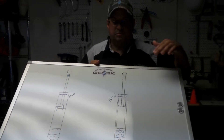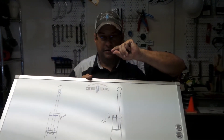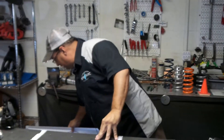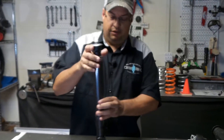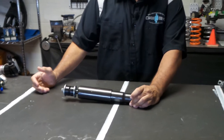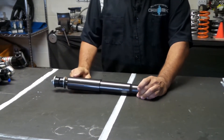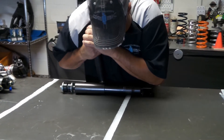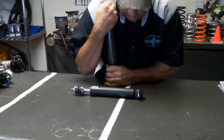At this point in 2020, there's negligible difference between mono tube and twin tube. Now let's look at a modern design. Here's a regular shock — over the counter, buy it at any auto parts store — and you can see how fast it comes up and out. It's kind of quick. Then you look at a new modern design — you can see how much slower that shock comes out.